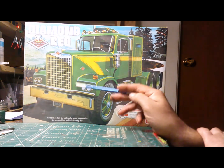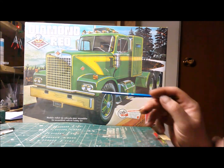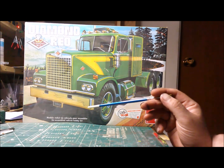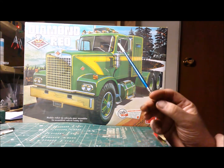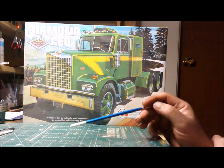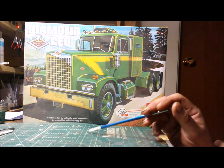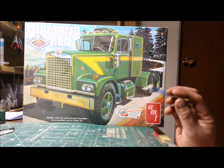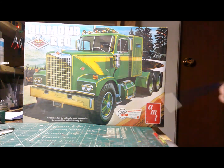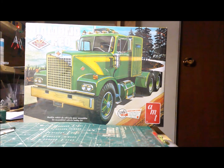We're going to be cutting that hood for airflow. The bumper should be okay. I have to add some little ladders here for the fenders. The gas tank should be okay. I also have to raise the cab up maybe a quarter to three-eighths of an inch. These trucks are lifted, and the rear suspension too — it's heavy-duty suspension on those trucks. I'll probably have to modify what we have here and source out taller tires.